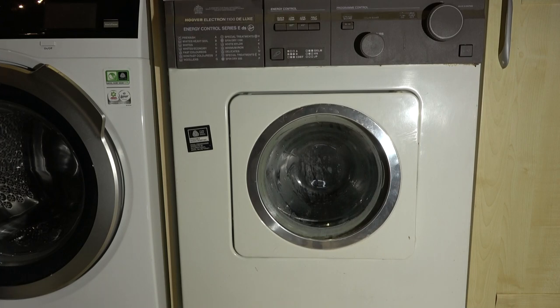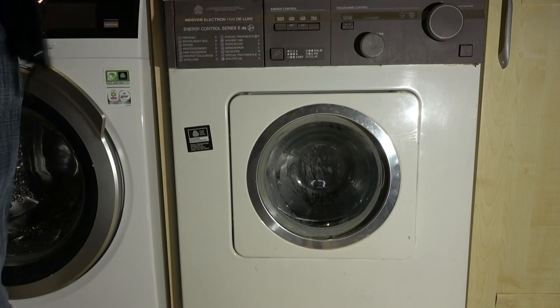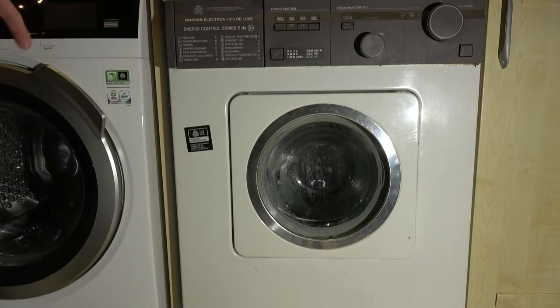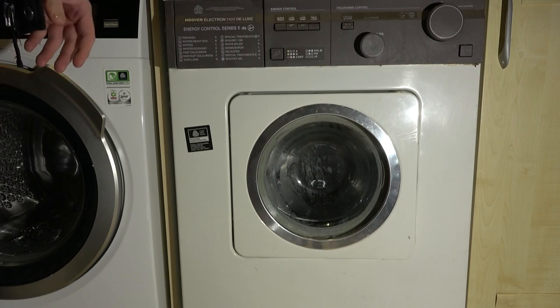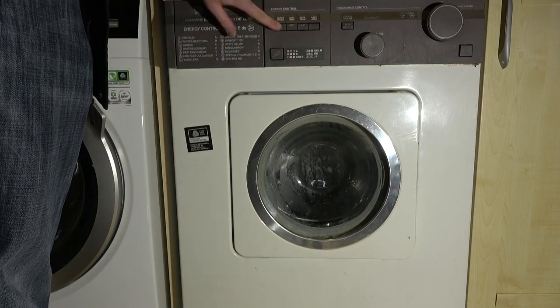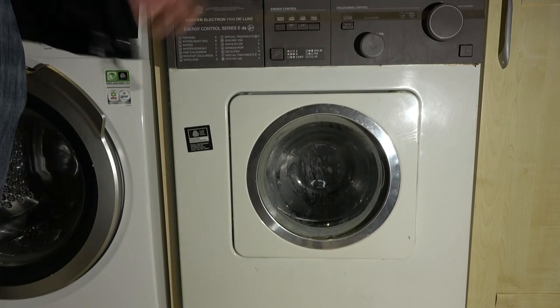The other thing is the quick wash button. You can use it on any cycle, and there isn't really much information about temperatures or anything like that. It does a timed heat with a short main wash, or a short heat section, doing wash tumbles more frequently. But there's nothing in the manual to say use it with Program L, and it doesn't say it only does 30 degrees. I'm sure people, even if they did read the manual, would have pressed that along with Program L and still expected it to do 50. No, it didn't.